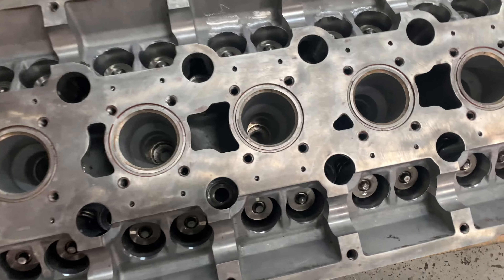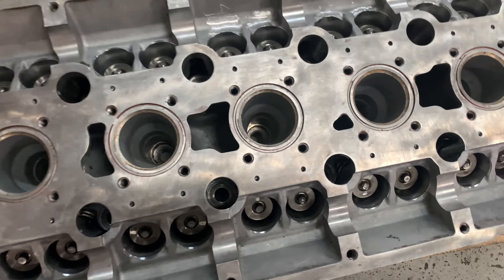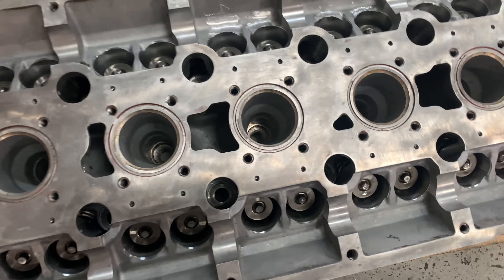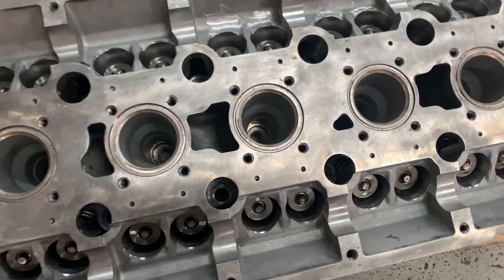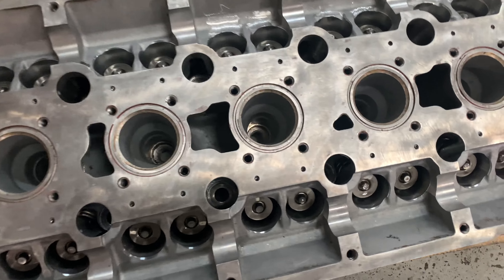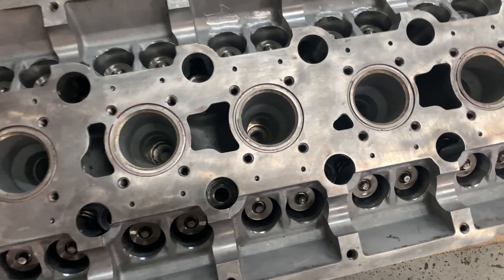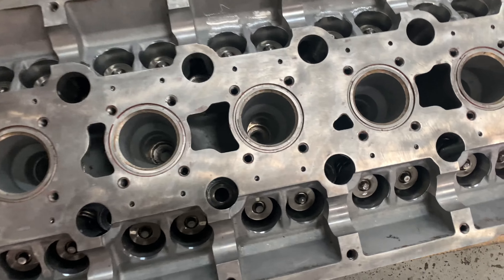I got the block flipped upside down and cleaned out all the head bolt holes two or three times with brake clean. I'm going to flip it back around once they're dry, clean the deck, and also clean out the oil drainage channels. I have a special fish tank cleaner type tool — basically just run these through with brake clean to get out any dirt. Definitely want to get the channels clean because once the head is on, it's kind of hard to clean those channels from this side.